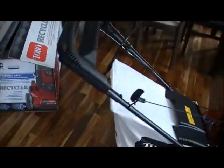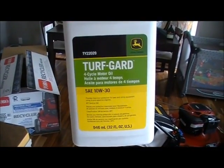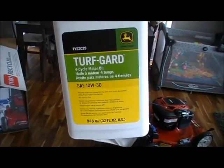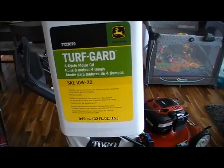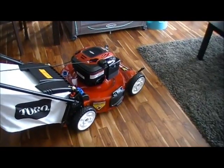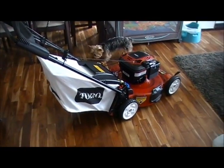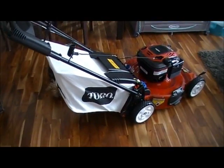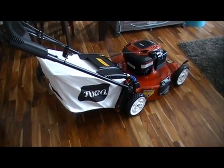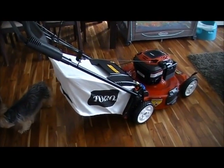I picked up a bottle of John Deere Turf Guard 10W30 oil. It's a slightly lighter weight — 10W30 versus a straight SAE 30 — but it's going to be very, very close. I grew up with John Deere big farm machinery, so that's why I bought the John Deere oil. Later I'll switch to some synthetic 10W30, probably Mobil One or Pennzoil Platinum or something like that.